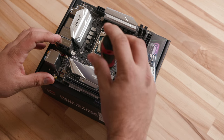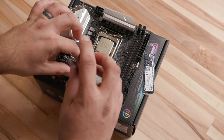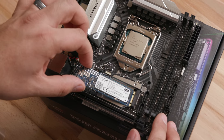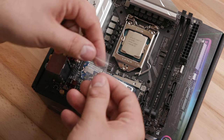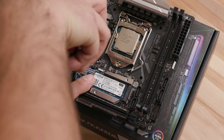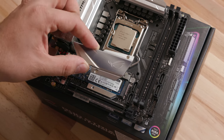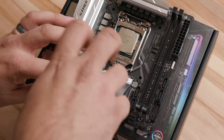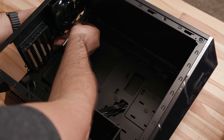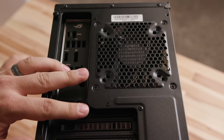Now I'm going to install my M.2 SSD. This motherboard has a little aluminum heat sink and cover, so we're going to take that off and put the actual SSD inside. The SSD is only going to fit in one way, so make sure that you don't force it in. The sticker side should be facing you if you bought one of these MX300s. Grab one of the little bolts and carefully tighten it down. You can peel off the backing for the little thermal pad and install the heat sink cover. Next, we're going to install the I/O shield — these can be a pain, so take your time, be careful not to get cut by the edges, and just apply some pressure on each end.